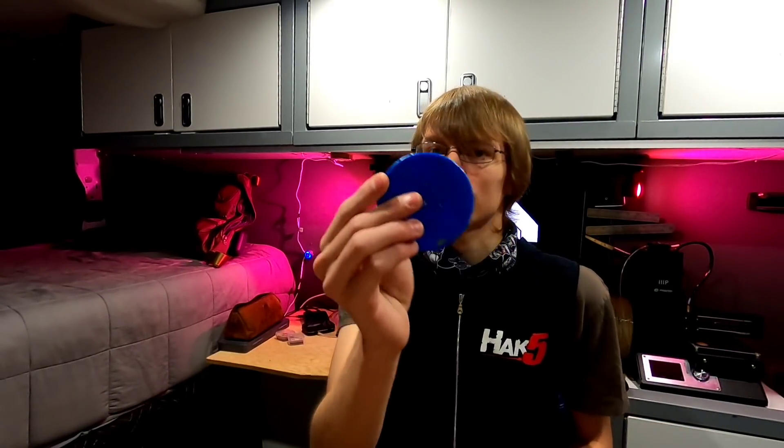As I mentioned in a few of my last videos, I got stuck down in Denver during a massive snowstorm on one of my trips, and it got down to negative 5 degrees wind chill, frozen roads and everything. This van hasn't spent much of its life out of the warmth and comfort of California, Washington, and so on, and when it did, it was during nice times of the year. So understandably, it had windshield wiper fluid that was only rated for freezing, not well below freezing into the negatives. So it froze, and this caused several issues. Obviously I couldn't use my windshield wipers, but it also broke this cap, and when it did end up thawing, it ended up sloshing about and making a bit of a mess.